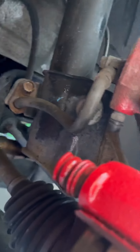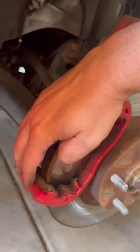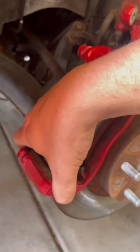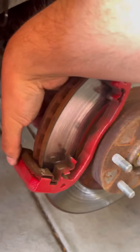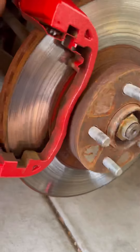Now with both bolts out, you don't want to put any stress on the brake line. Take the caliper and prop it on top of the rotor — it's really important you don't want it to dangle from the brake line. The front brake pad I already took out; the back one will just slide out like that. The hardware is clipped on there, so just poke around at it and it'll come out. Off goes one, and off goes the other.